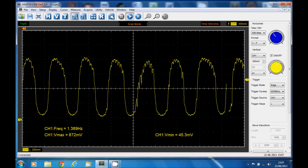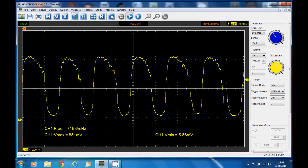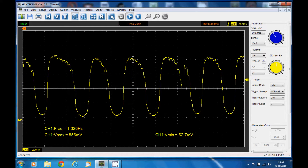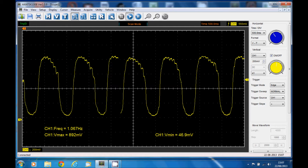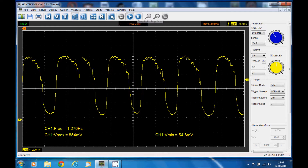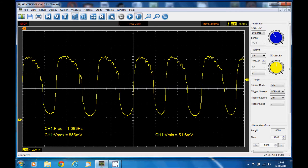Alright, now at 2,000 RPM, and as you can see the upper voltage is above 800mV which is good, and the lower voltage is below 200mV. I am just going to pause it here now and expand it.